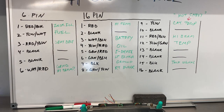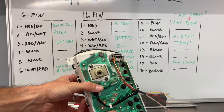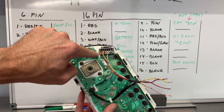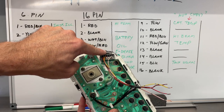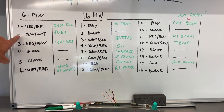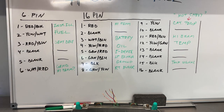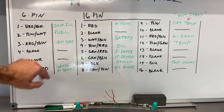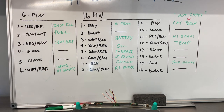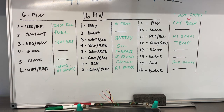I'll keep the 16-pin and 6-pin up at the same time so we have it all in one spot. On the 6-pin, position one is far left with the plug plugged in. Pin 1 red-and-black is instrument illumination. Pin 2 yellow-white is your fuel. Pin 3 red-and-yellow is your seat belt — new for the '96, my '91 didn't have that. Pins 4 and 5 are blank. Pin 6 is a white-and-red wire which could potentially be a ground for the high beam. Once we get inside the '96 truck and look at what wires are behind that single plug, we'll track that down.